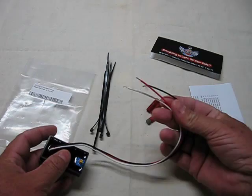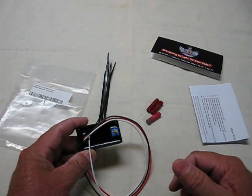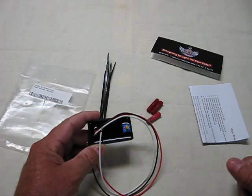The module itself is pretty basic — that's one of the reasons I chose this. Three wires. Basically, you cut your brake line, tap in and out of it, and ground the other wire. It also has a dial with ten selections giving you different flash patterns. The first four are a slower flash pattern, used for incandescent lights as well as LEDs. The final six patterns are higher speed, specifically for LEDs — the lights that can handle the speed.